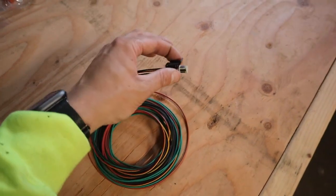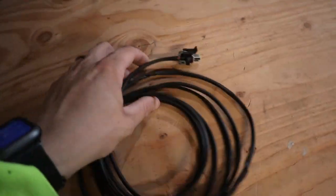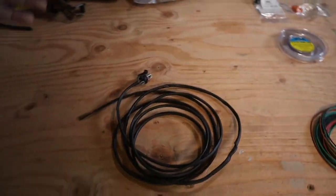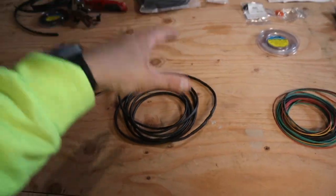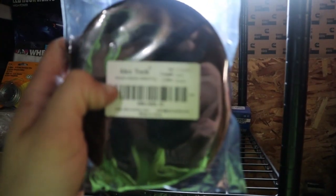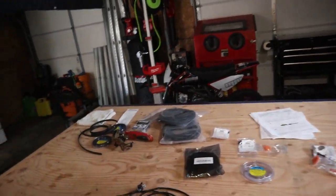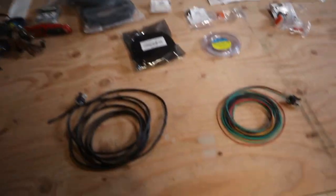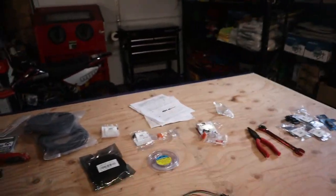Here's one of the wiring harnesses for one of the sensors. I grabbed some quarter-inch heat shrink wrap and decided to wrap the whole wiring harness. I'll show you the difference real quick — I think it looks a lot better. I'm also going to wrap it in some quarter-inch plastic loom for now until I get more of the nylon stuff, because unfortunately all I have right now is three-quarter and one-inch. In my opinion, the nylon stuff looks a lot cleaner than the cheap-looking plastic loom, but nowhere around here carries the nylon, so I have to order it online. Maybe it's overkill since it'll be wrapped anyway, but I think it looks a lot better than just exposed wires.